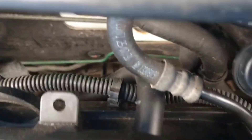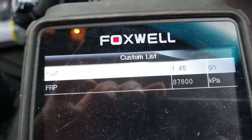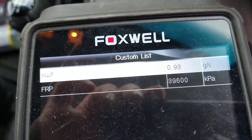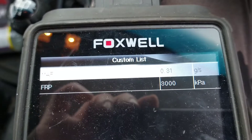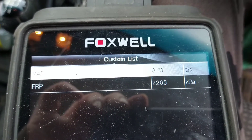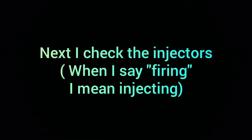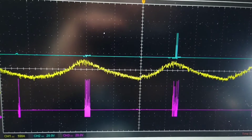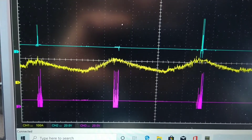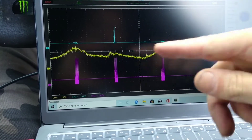The EGR was the other thing to check, so I'll try and see what's next easiest to get to. Cranking again — it does sound like it's going to try and go, but it isn't. The kPa is coming up and the grams per second is coming up, which is quite good now. So I've got a believable fuel rail pressure. The grams per second is coming up; it's just not staying there. See, it almost wants to start. But here we've got one compression, another compression, another one — it's like it's firing every two.